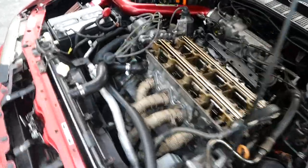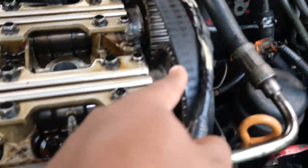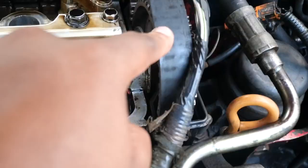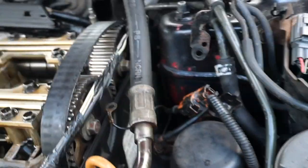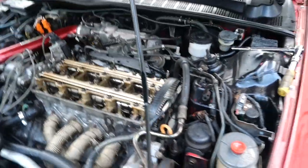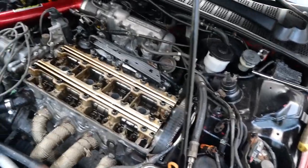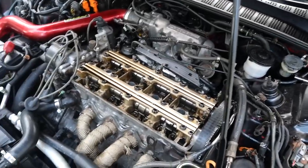Alright, so I don't know if the camera captured that, but as I was recording b-roll the car died out of nowhere. Look what we have here — this is the timing belt. Not only is it worn, but there are these marks on there and it's wet with oil too. If you look at the cam gears, they are now out of time — this one is facing up and it was facing to the right on the intake side. This is probably the worst case scenario. I pulled the valve cover just to confirm — I damn near knew it was timing related. So project Prelude is back down. I don't know what I'm gonna do — we got a very big new problem.